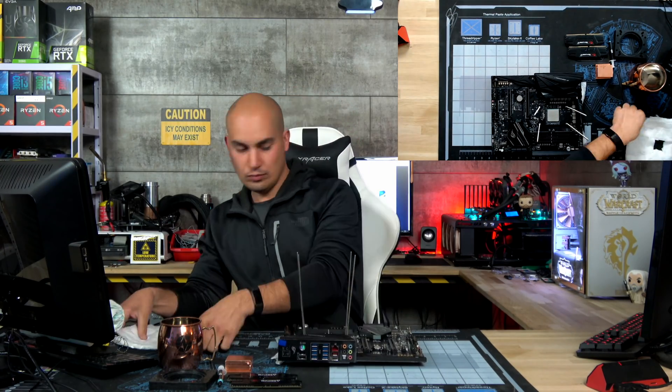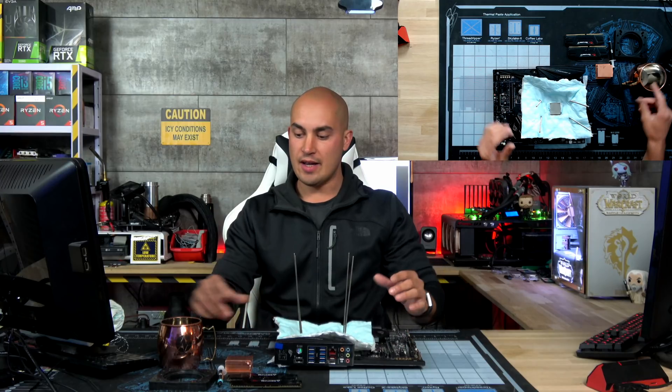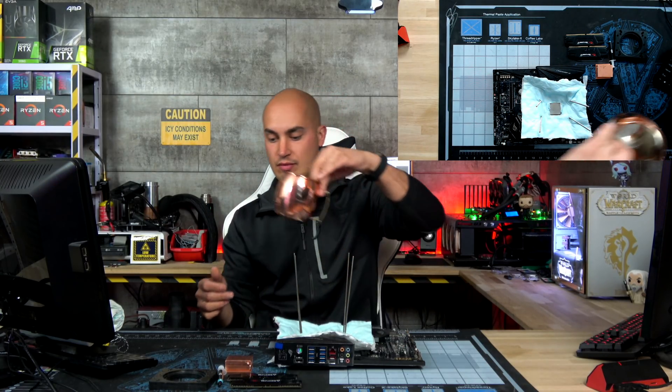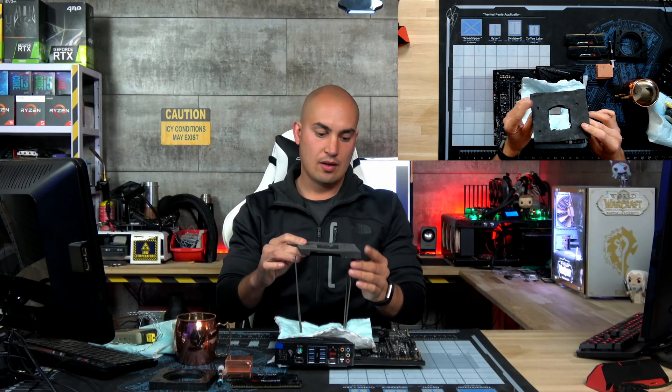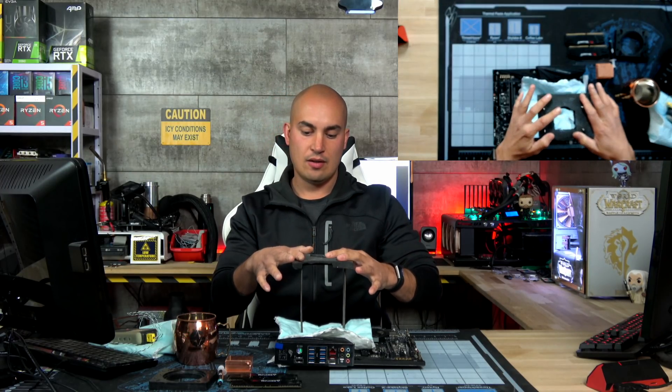As you can see here, I have a piece of neoprene to place in the back of the motherboard, along with my diapers. The good thing about this system is I have one layer used to catch the water and moisture, and another layer which is waterproof, so I can prevent water from dripping onto the motherboard. I place the first layer and then another piece of neoprene. It's very important to catch the water, but also to keep everything well insulated, because if there's no air, there's no condensation. A good level of isolation is key.